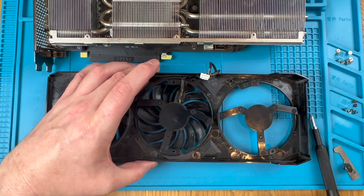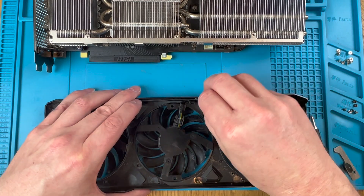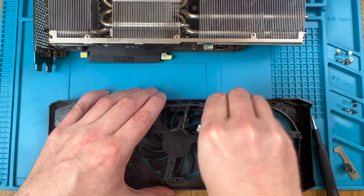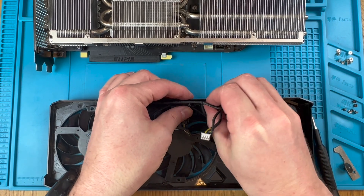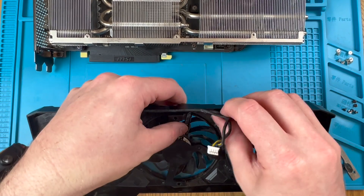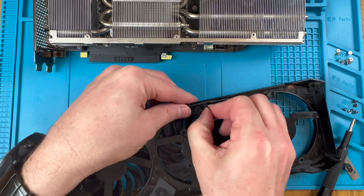You can pop the fans off the shroud by gently pushing the base of the fans away like you see here. The furthest fan on the right can be easily removed and put to one side. Before removing the other two, let's release the cable from behind its plastic clips. Be careful here — simply pulling on the cable will probably result in it becoming caught on the clip and getting damaged. Instead, slide the cable along while easing it out and this way it shouldn't get caught. Repeat this for the cable for each fan.